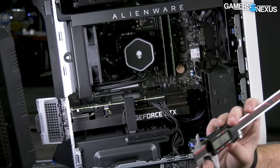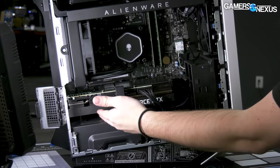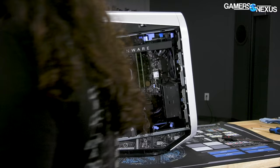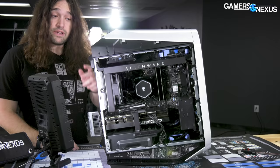There's about 14 millimeters of space for the GPU to breathe — that's not great. The GPU is air cooled, on a two-fan video card. That card, if it's the same Dell 3090 as we saw before, is actually not completely terrible, but it's not going to do well where they've shoved it.